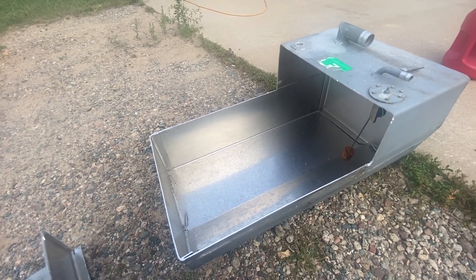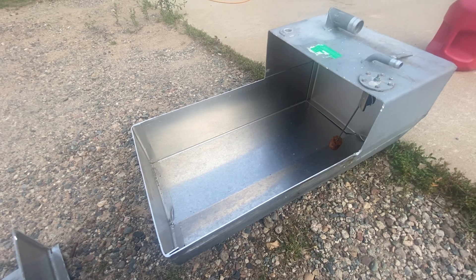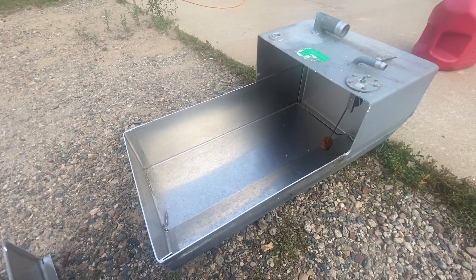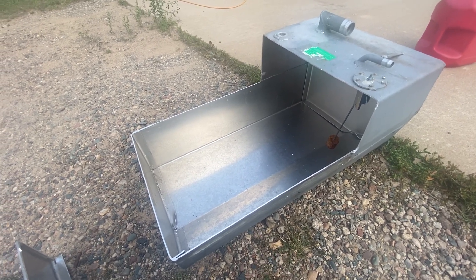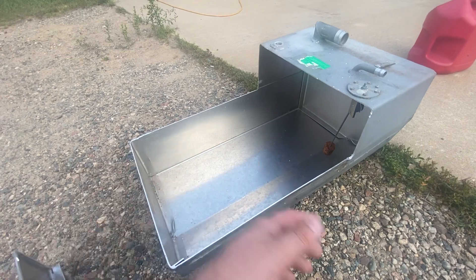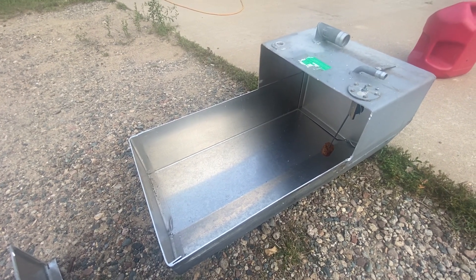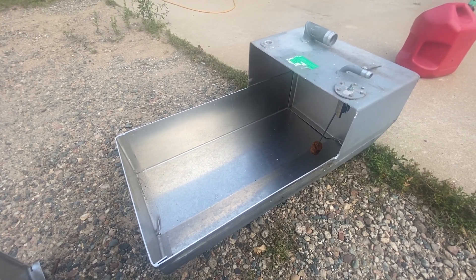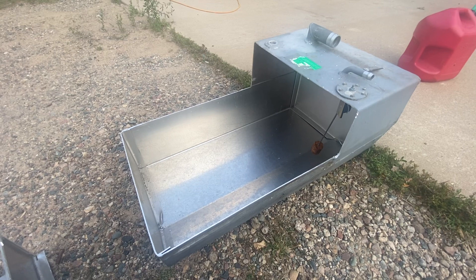This is a carbureted style tank, so there's only one pump pickup for it. There's no return and there's no sump or baffle or anything to try to keep the fuel around the fuel pump. That's a problem with EFI. With a carburetor, you have like a cup or so of fuel in the fuel bowl, so if the fuel sloshes away from the pickup, the engine just keeps running on what's in the carb bowls. With an EFI system, if the pump inlet becomes uncovered, it instantly loses fuel pressure and the engine will just shut off.